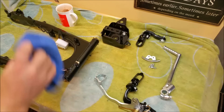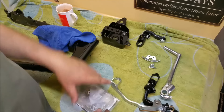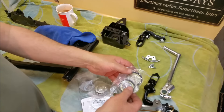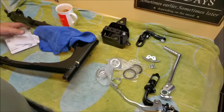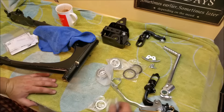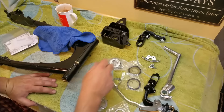Before we put any of this on, the first thing we've got to do is hit the bike with these steering bearings. These can go on for now just to keep them off the bench, but of course they'll have to come off again when we put the engine in. These are the steering bearings — of course we've got two seals, two tapered roller bearings, two spacers, and some instructions. What they're telling us to do is measure the thickness of the old bearings before we put the new ones in. This is the bottom one — when we put the bottom one on, we've just got to make sure they're the right thickness, because if they're wrong it can be a hassle. The top one's easy because you can just take it off or put it on according to the height you want. But the bottom is fairly critical because it does have to be pressed.